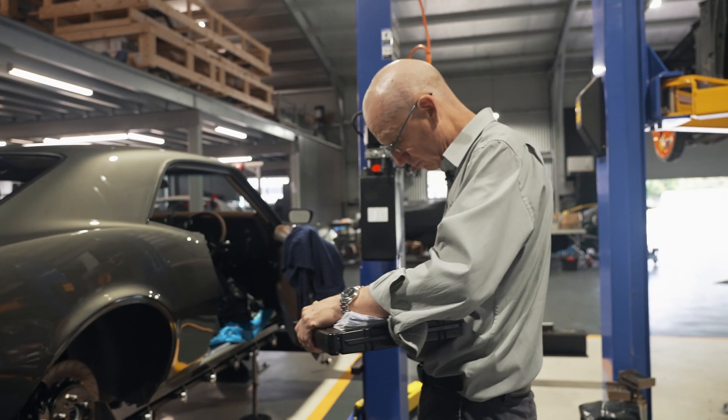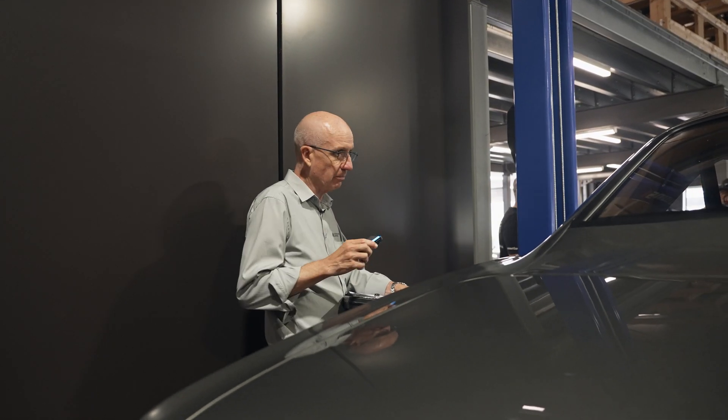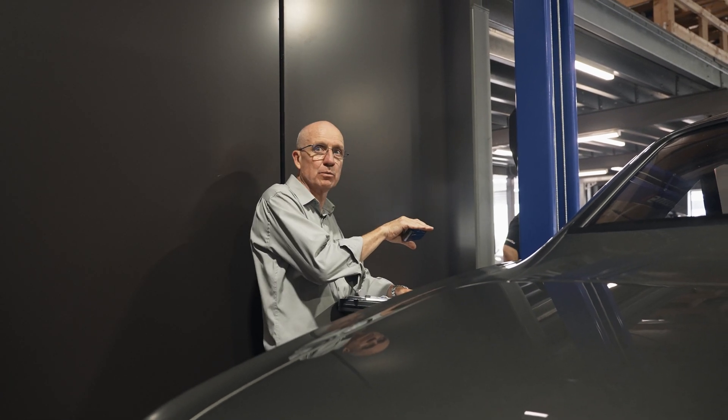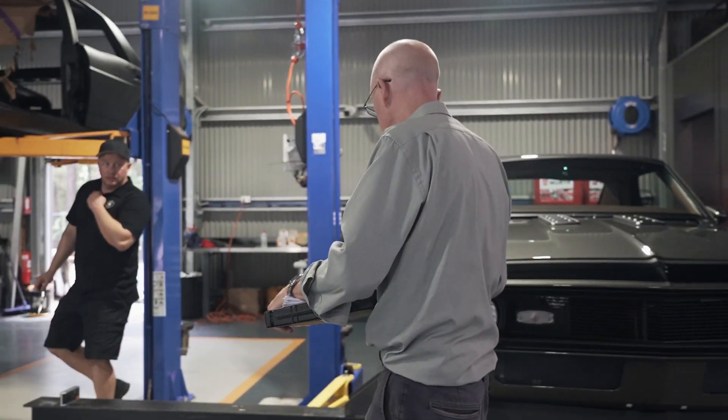Reading the dial gauges: 72, then 98. So that's very little deflection but it's the right shape — a little bit at the edge, down to a bit more in the centre, then back out: 0.4, and that one's on 0.2. We're two metres off there and we're going to check that. That result is outstanding. I've obviously got some calculations to do to show it in greater detail, but all the numbers make a lot of sense — very little deflection, very little twist.